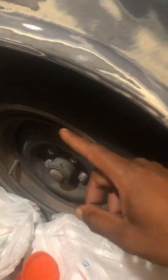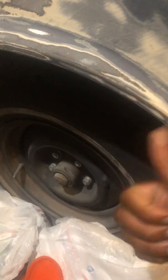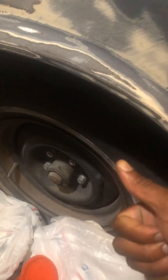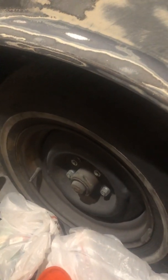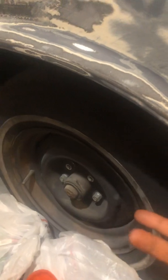All right, so if you don't know, I need a 2000 to 2004, I think he said, Chevy Trailblazer two-wheel drive front spindles, and it comes with a little bracket that allows me to mount the caliper to the spindle, and then the rotor slides on the hub. I need new hubs, and then brake lines, and then I should be able to run it.